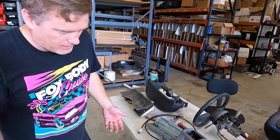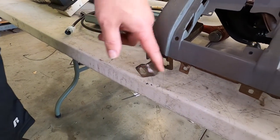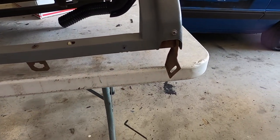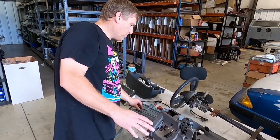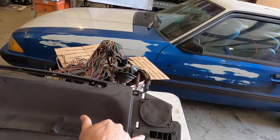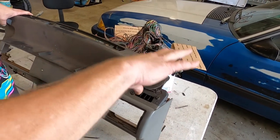If you're completely removing the dash — which I recommend — you do need to disconnect all the electrical connections, because the dash wiring harness is attached to the dash itself. You can separate it from the dash, but it's a lot more work than just unplugging everything. Now starting on the retaining screws: one is underneath the steering column — the main reason you drop it first. You just need to loosen it, not remove it completely; there's a V-groove the stud and nut will slide through. Then you've got your main retaining screws — one down in the corner on each side. You need to remove the kick panels to access those. Those are 8 millimeter head screws.